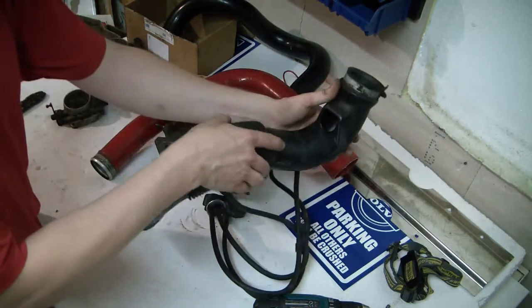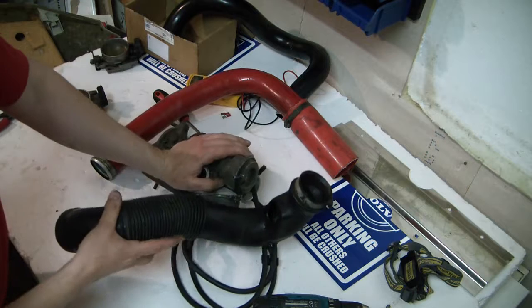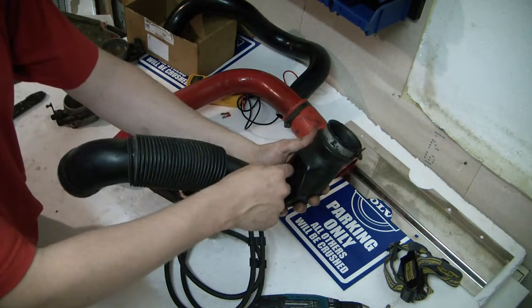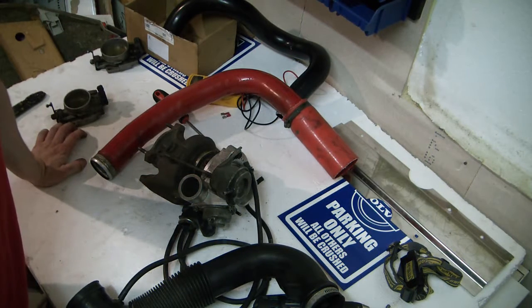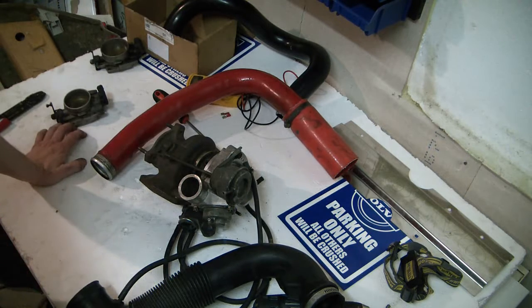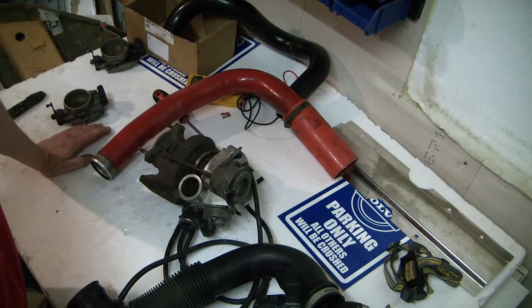Here you have the warming sensor and the crank ventilation connector — this is also a place where you can have air leaks. One way to test for air leaks is to have the car at idle and spray starting fluid around the engine; see when the engine revs up. I have also used brake cleaner since it's also combustible. Spraying a flammable liquid on the hot turbo side is perhaps not recommended. Thank you — if you want, subscribe; I'll try to make more videos as time goes by.